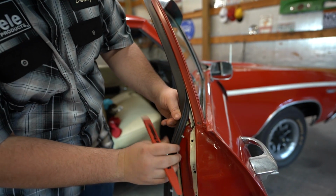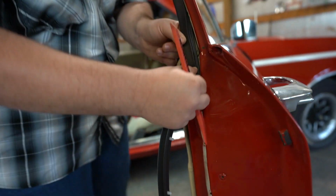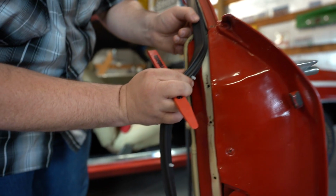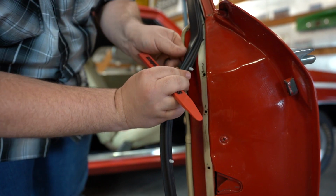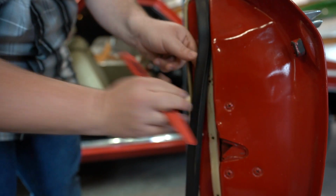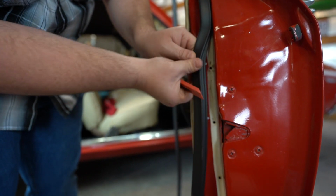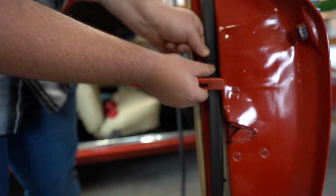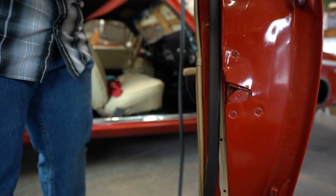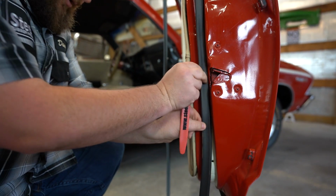All right, so now we're at the clips. We'll go ahead and start placing these. Sometimes these can be a little bit of a bugger because you're trying to push on something that has a really soft top. But if you need to, and the clips aren't going in, which these are going in pretty good right now, you can get something, a piece of wood, or this tuck tool to press on top and place the pin. And we'll just continue to follow these along.